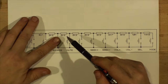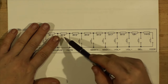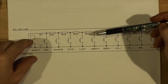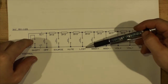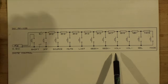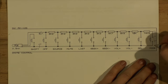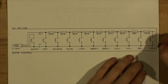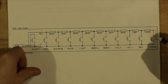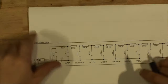If you add another 2.2k resistor — so now you have 2.2 + 2.2 = 4.4 kΩ — that's Mute. At 6.6 kΩ it's List, and so on — they add up in series. In my case this stereo has a termination resistor at the end, which is causing a problem. When it boots it's already seeing about 38 kΩ resistance and the stereo is confused, thinking a button is being pressed. We're going to fix that.